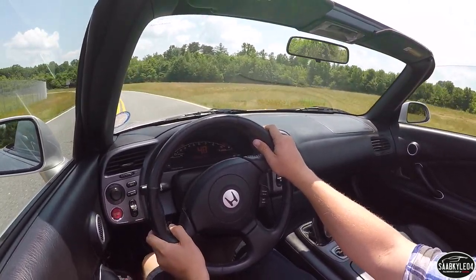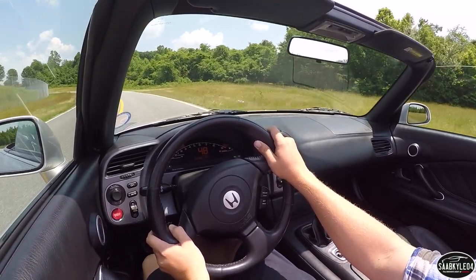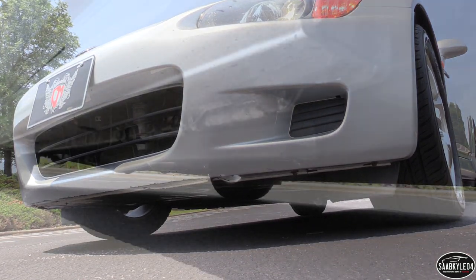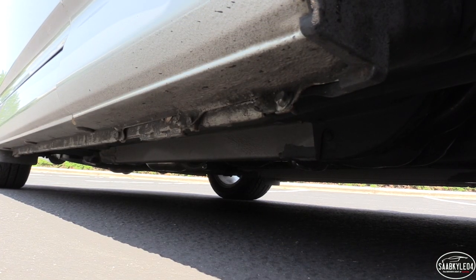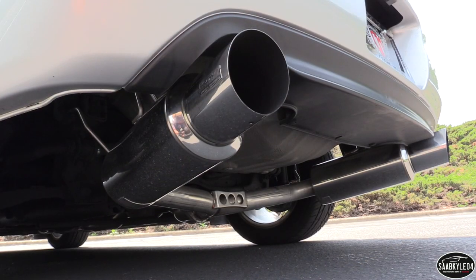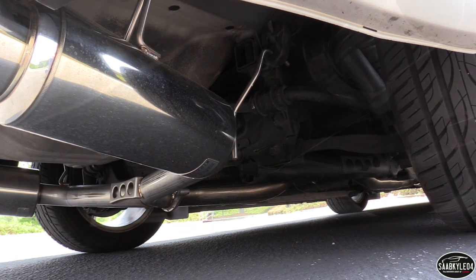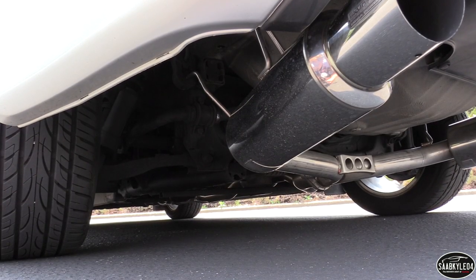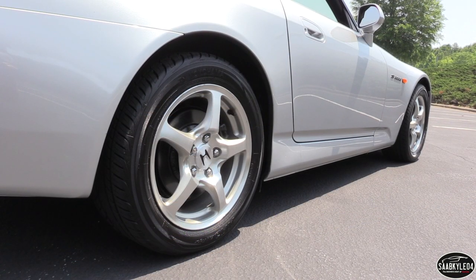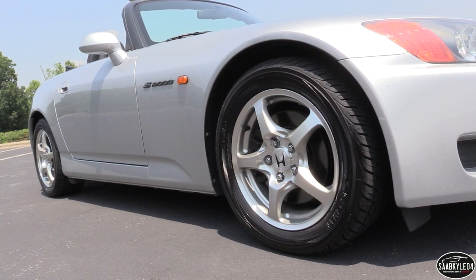The wishbones are mounted to the body via specially developed rubber bushings to minimize the amount of road vibrations transferred to the interior. In the S2000's case, stiffness does not mean a choppy and uncomfortable ride. It's certainly firm, but it's surprisingly smooth. The impressive chassis rigidity allows the suspension to do its work unencumbered, pretty much eliminating any form of cowl shake and unpleasantness over rougher pavement. The S2000 is a proper sports car in every imaginable way that rewards the driver consistently.